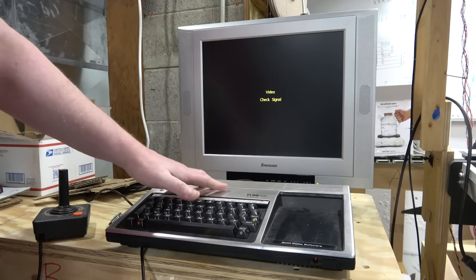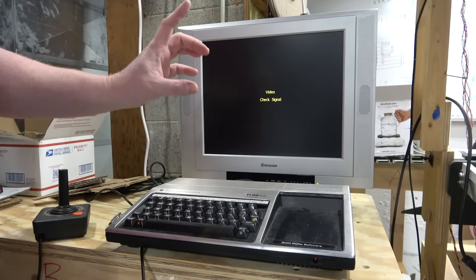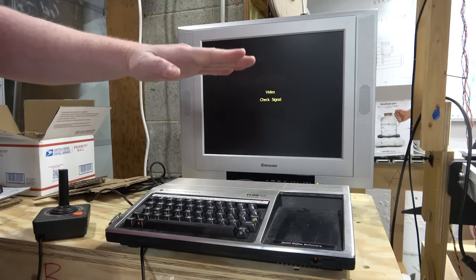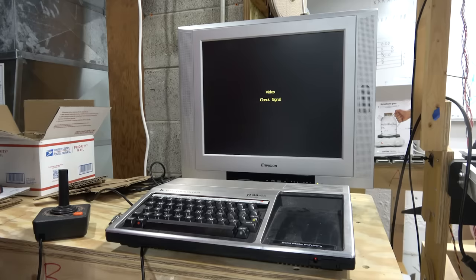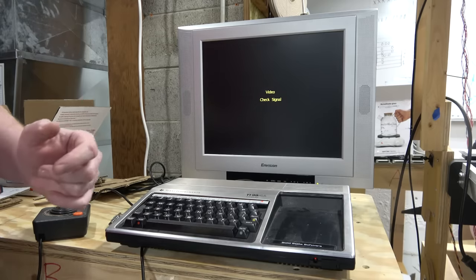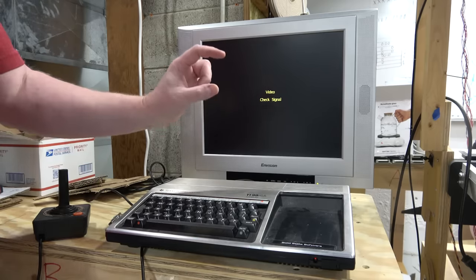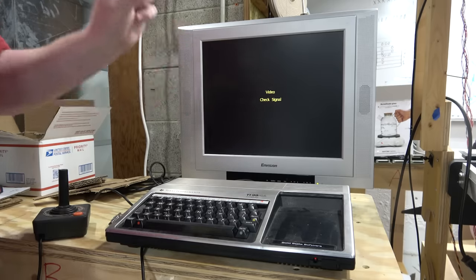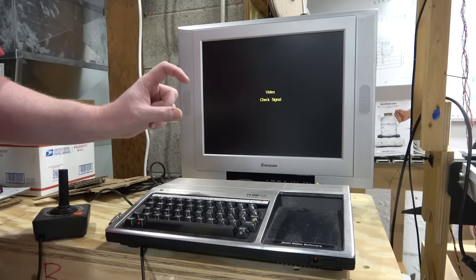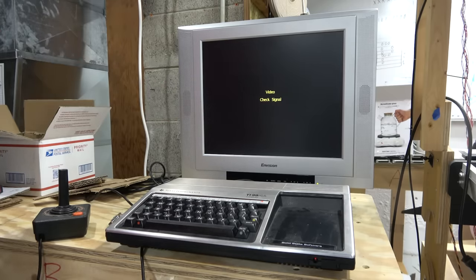Like, one of the graphics modes on this, what is it? Each character, you can have two colors per line of the character, or row. I think there's only 16 colors total in the system and you can't change them. Yeah, but that could mean you could get up to 16 colors in one 8-pixel by 8-pixel space. Yeah, because it could be 8 times 2. So yeah, you can actually get some decent graphics out of this.